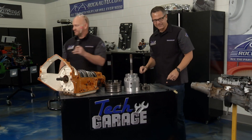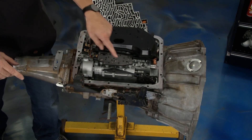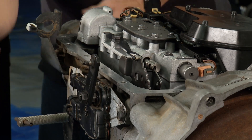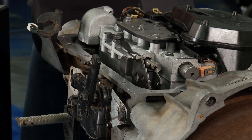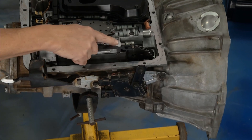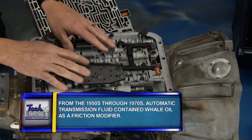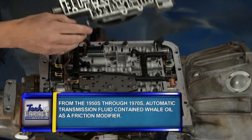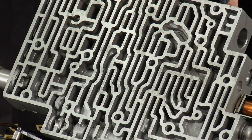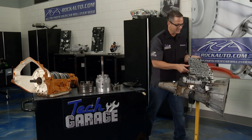Let's look at the transmission and what's going on when we shift it. This is the shift solenoid and this is the manual shift valve. If I reach under here and shift this, you can see I'm pulling that cable — the cable's hooked up right here. When we pull it we're moving through the different gears. What we're doing is moving the actual shift valve. Look inside the valve body — you can see all these passages where the fluid is directed into different clutch packs. On the other side, all these worm passages direct fluid to one part or another of the transmission, holding or releasing different clutch packs to give you all the different gears.